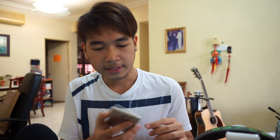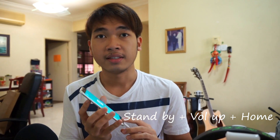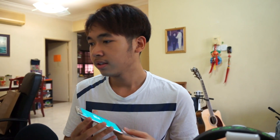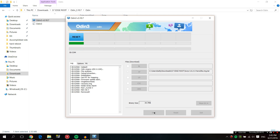Once that's loaded, before we start the process, have your phone ready in your hands. Once the installation is done, you have to quickly head into recovery mode — do not let your phone boot into its normal system. To enter recovery mode, press all three buttons at the same time: standby button, volume up, and home button all at once.